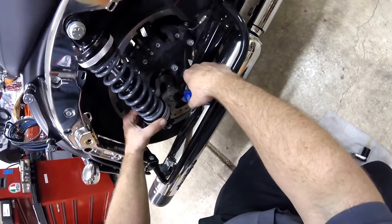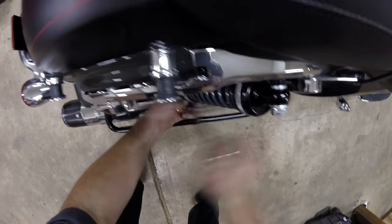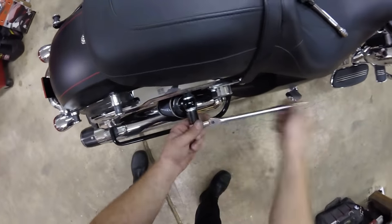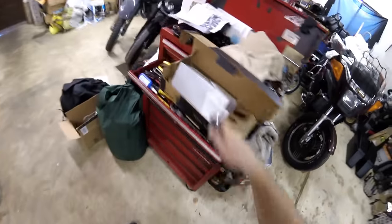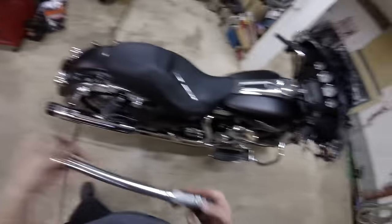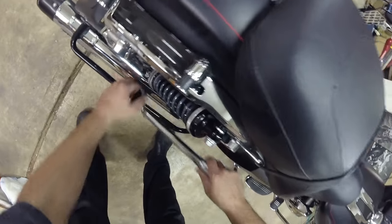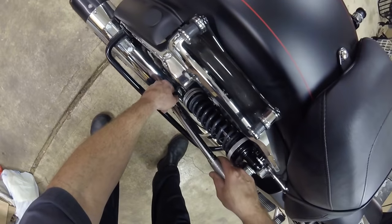So put a little shot on the inside there, snug this side down. Nifty-difty, cheesy torque wrench. The spec on the shock bolts is 35 to 40. I'm just doing 37. There's no specific order in which you need to do these.